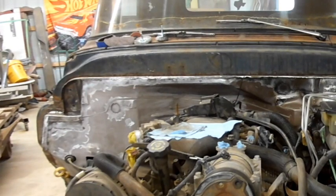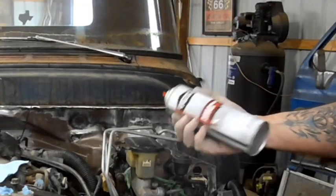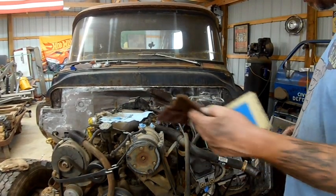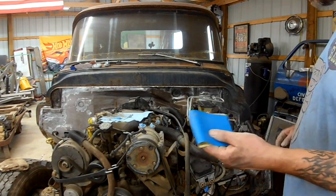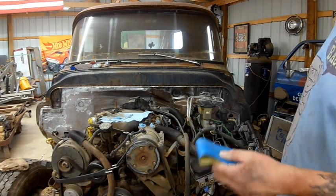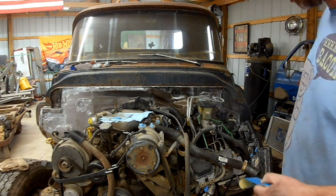All right, you can see I've got most of that side sanded. I got everything cleaned up pretty good with a wire brush and an appropriate degreaser. Went back with the half a sheet of Scotch-Brite I had. That wasn't working very good, so now we're using some 320. Really, I just need to scuff it up so that the paint will have something to grab. 320 is plenty, but it's still smooth enough that it shouldn't leave big gouges that are visible in the paint. And all we're trying to do is basically make it not stick out, so it just disappears behind the engine.